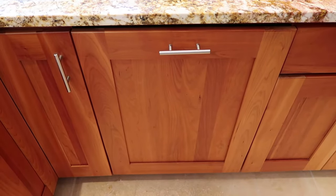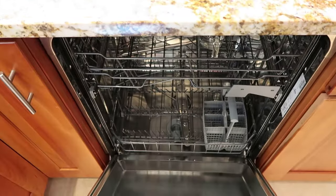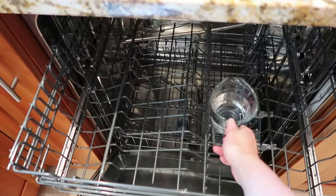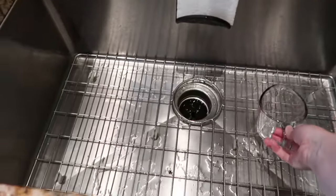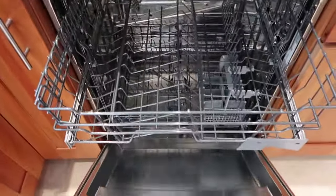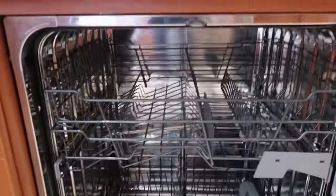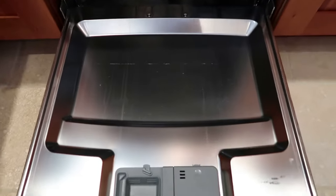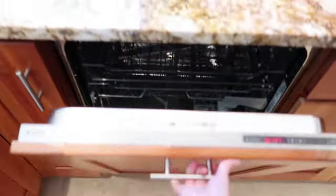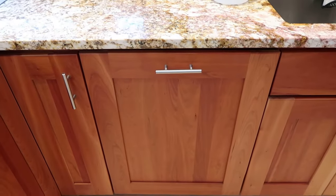It is that simple. When your cycle is done, just open up your dishwasher and take out the cup that you placed your vinegar in. It's probably going to be filled with a mix of vinegar and water still — that's okay. Dump it out in the sink, and you're all done. You have successfully deep cleaned your dishwasher. As a reminder, I recommend doing this full three-part deep clean of your dishwasher every two to three months to ensure it stays running at its peak performance and it's nice and clean inside. Thanks for joining me on this how-to video. I'd love to know if this works for you, so let me know in the comments below.